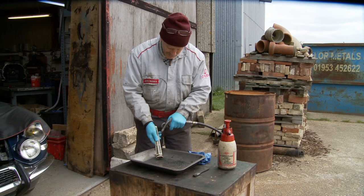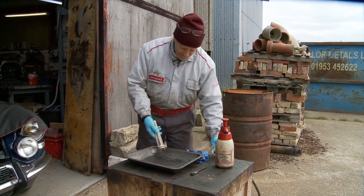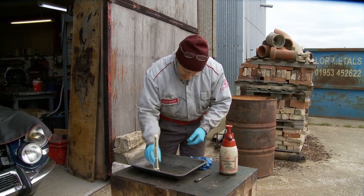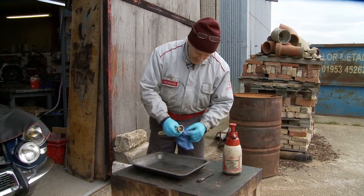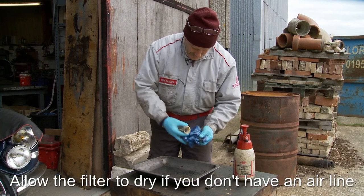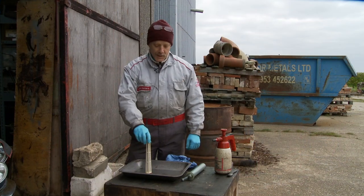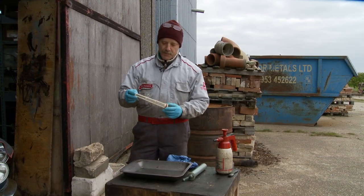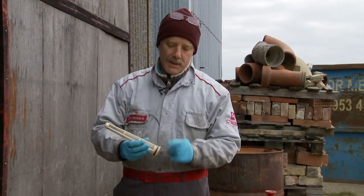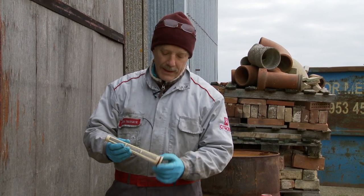You can see in the bottom of the tank how much stuff there is. You should be able to see through the filter — this one is nearly completely clean. Just take your time. Here we have a clean hydraulic filter, and this one is for the LHS. As you can see, it's cream, and the O-ring at the bottom has got a red stripe on it, which denotes it as being particular to the LHS.